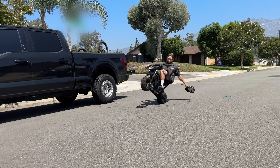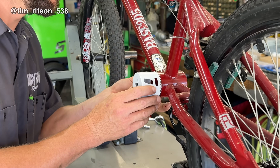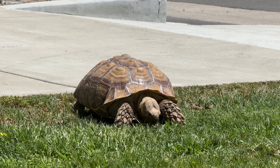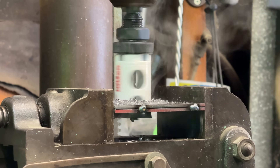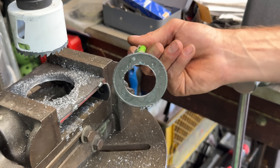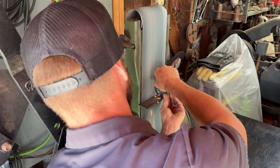Tim's loving the wheelie fun bike but it's time to grind. He's sizing everything out before cutting two squares of steel, tacking them together, drilling a small hole through both squares and then a larger hole. What pops out are two identical, perfectly sized spacers that you can't just buy from a store — exactly what I need to adapt the kit to the BMX bracket.